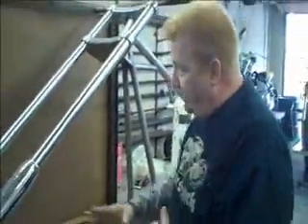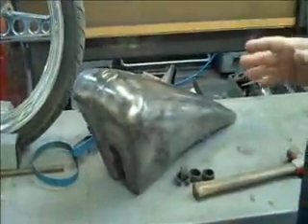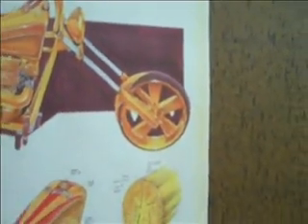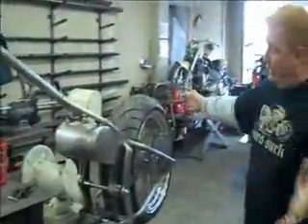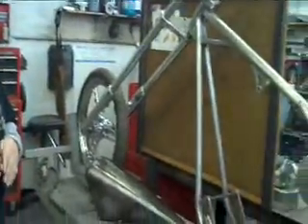As we're just getting started, there are some important pieces to initially get in place. We've been working on the gas tank, getting it hammered out in basic form to do some fitment tests. We've got a programmer working on drawing a program for these wheels so we can do some three-dimensional imaging of the wheels, and then we'll cut those from solid chunks. This is the frame and the basic stance of the bike. We're just starting to fit some big components to it, to answer some questions and give us direction as we get into the specifics of really making it the Arizona Centennial Chopper.